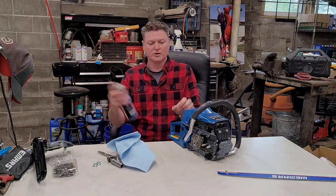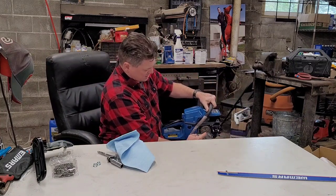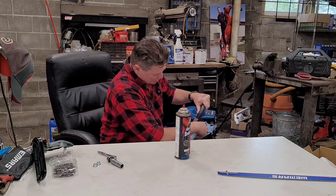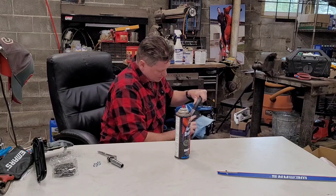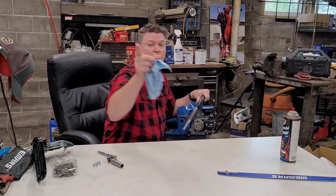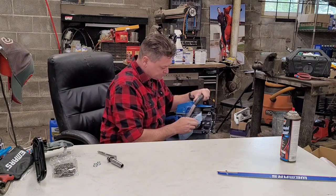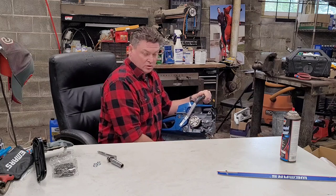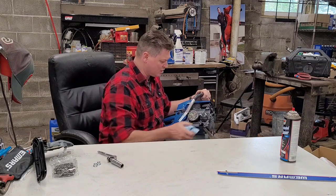All right, little known fact, these things often come greasy from the factory. And that clutch will slip immediately because it's all oily from the factory. So, a little bit of brake cleaner. Use non-chlorinated brake cleaner. Non-chlorinated will have less tendency to give noxious fumes, I think.